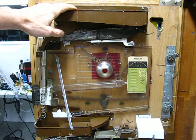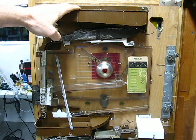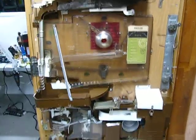When this ball hopper is filled with balls — these are the balls that are paid out for wins — the machine functions perfectly. You can play the game and it pays out wins. When the machine hopper goes empty, the machine locks up. You can't play the game and you don't collect any winnings. It's basically like a tilt in pinball until the hopper's refilled. So my idea was to lock out the machine by emptying the hopper, placing balls in the front of the machine into the pockets where they would stack up, and you can see on the back of the machine where those balls reside now.